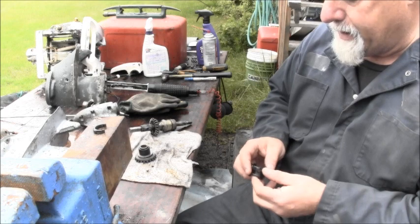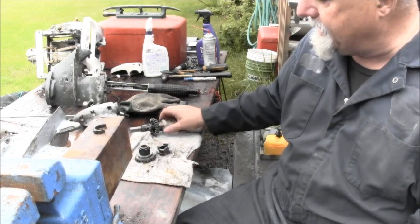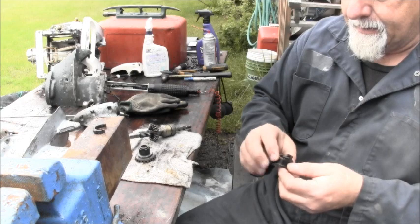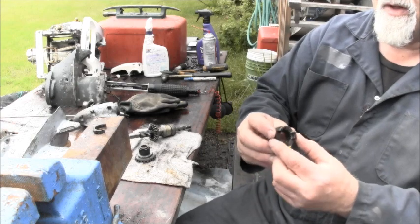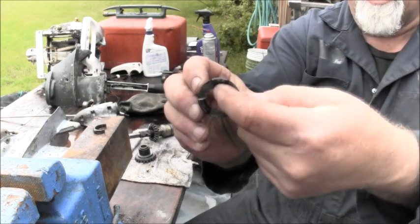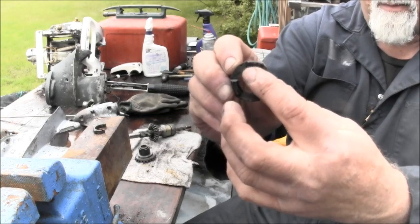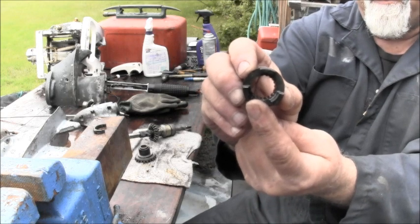When you go to put the clutch dog itself back over the spring and detent balls, one of the three lugs has what they call a ramp. And opposite, okay, so this is the lug with the ramp. It has a little ramp, they call it, right here. It's a little cutaway that's chamfered, scarfed at an angle so that it will slide up and those detent balls will roll under it. Opposite this single lug will be the other ramp, okay?